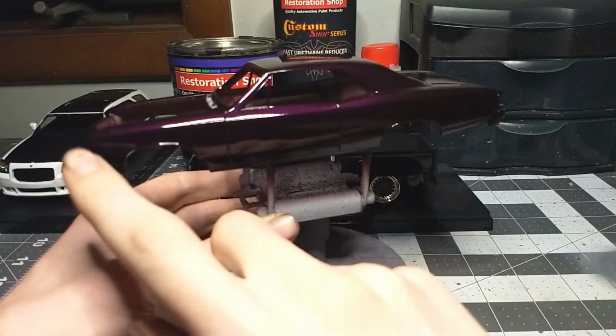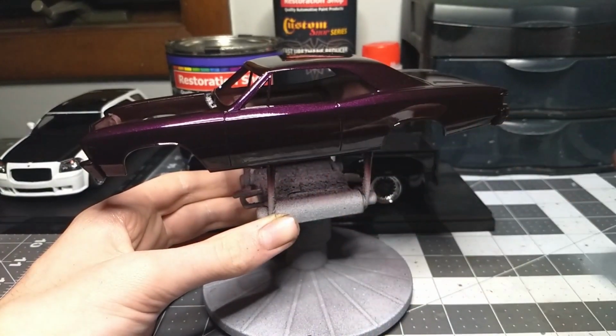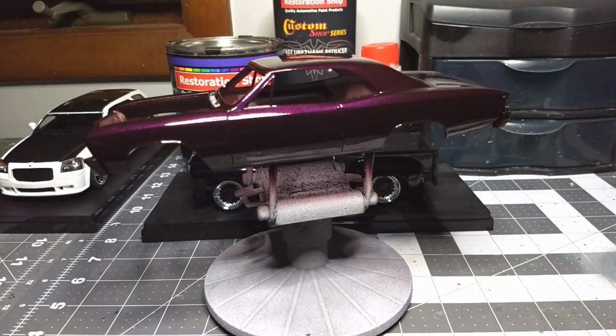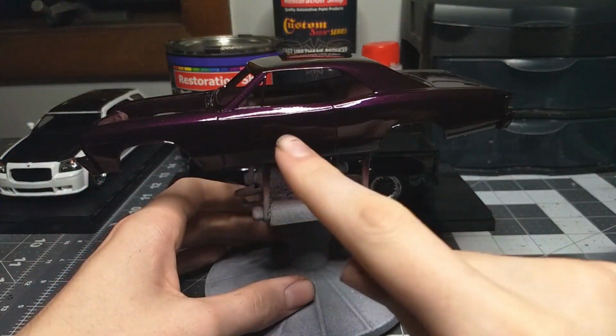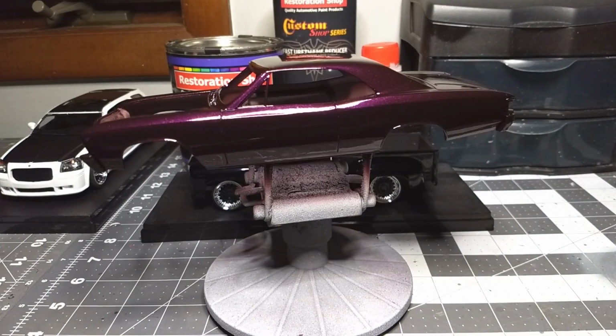So like I said, if it's a very long decal that goes from one side of the car to the other side, or like a sponsor or whatever, if you put at least 1 to 2 coats of clear, it will help that decal. You can straighten it out where you need to move it, and then you can clear on top of the decal on top of the clear coat.